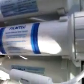Earlier I was talking about arrows on your filters — originally when you first get the machine, they should all be facing upflow. The arrow should be pointing up for all filters except for the reverse osmosis. The reverse osmosis filter always flows downward. Water from the reverse osmosis comes in through the top and leaves out of the second port in the bottom. The front port leads right back to your bottom tank. Only 37% of the water pumped through the reverse osmosis membrane actually gets through it and makes it to your top tank.